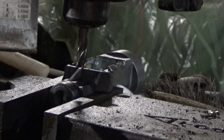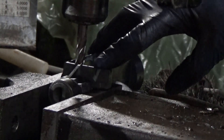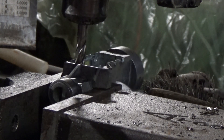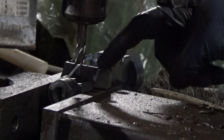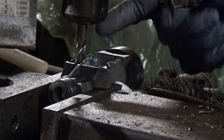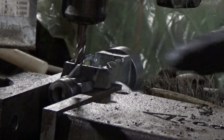I've got that lid off, so I'm all set up. I've put two marks on — one you can't see, there's one there and one round here. Set this up on the milling machine and all I'm going to do is just take that lip off there. There's a ridge in the casting, so that's going to be my depth.